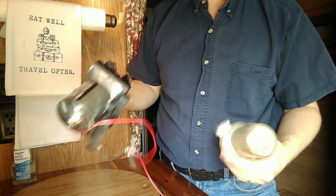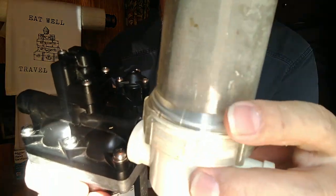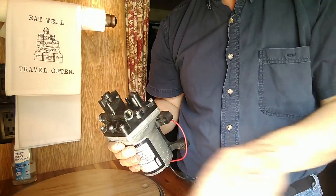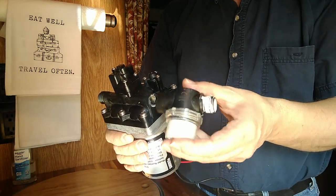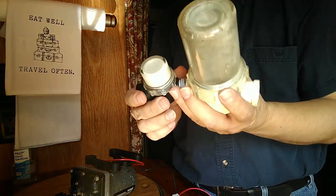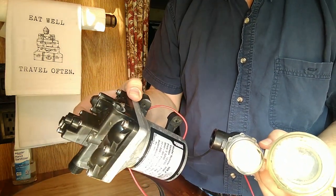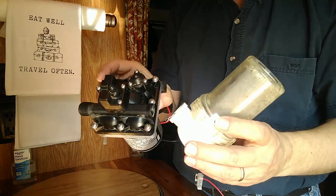Simple enough, except that when I tried to make that connection, I screwed it in and I snapped the plastic. I think what happened was that a long time ago when I was assembling the pump, it actually started to weaken the plastic — I heard a little bit of a crack sound. The problem is you've got a big physical lever, and messing around with trying to clean the filter repeatedly is causing a lot of stress on that connection. Eventually it broke loose as I was trying to snug up the fitting.